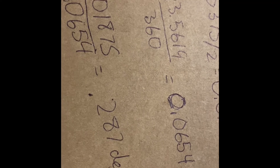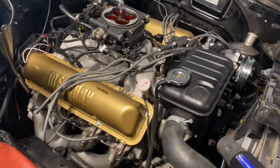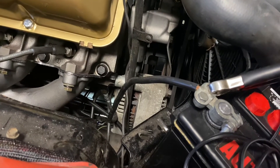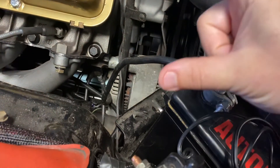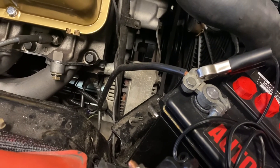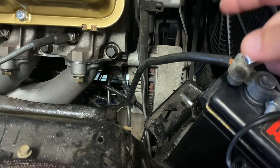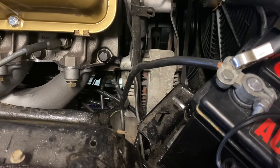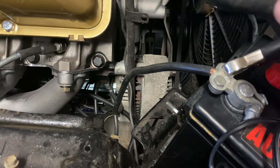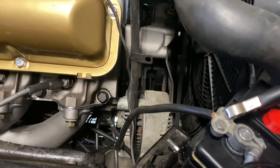So I can say that my balancer and timing mark are accurate. Time to pull out the piston stop and put the spark plug back in. Now, what would I do if the timing marks were off? In my case I don't have to do anything, but the options would be to loosen up the bolts or take the timing pointer off completely, slot the holes, and adjust the pointer. If I was off by a couple degrees I might only get an eighth of an inch of adjustment, which is about two degrees. If it were more than that, I'd need to cover up the marks on the balancer with timing tape and put that tape at true zero. But in this case we're all good — I can time based on the marks on that balancer. It's a Professional Products standard 390 balancer, not SFI approved, but at least for my car it's accurate.